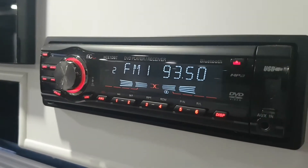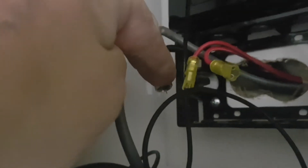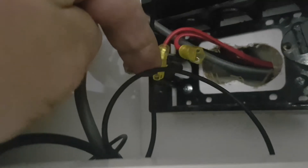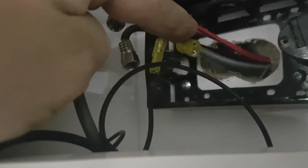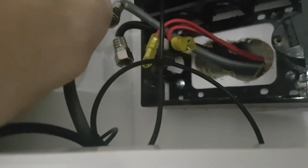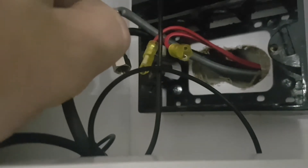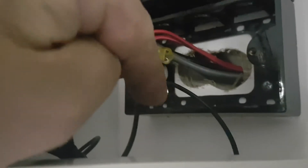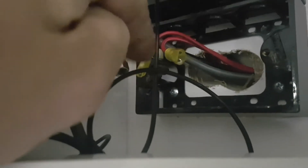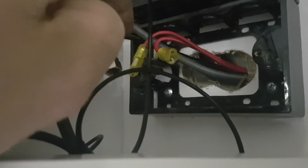My radio over here is my test subject at the time. Here's the wiring: one's your input, one's your output, and then you've got this — this is actually an earth. Some idiots use red wire to run earths in a caravan. I cannot believe someone would do that. Maybe it's cheaper; maybe you should follow the right regs. This one here is your power.